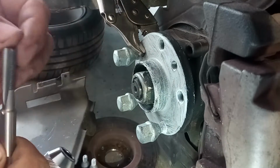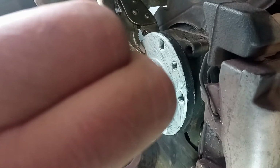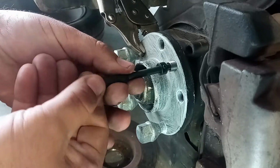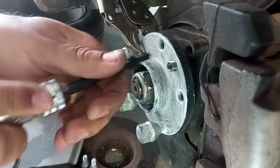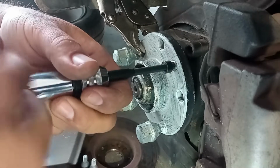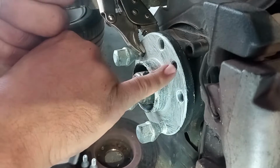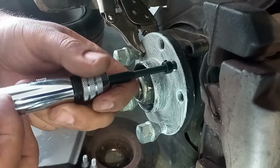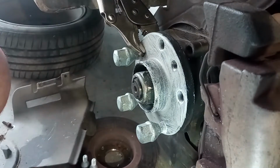This tool here comes with a repair kit, like I said. Also on the repair kit we have a driver over here. I like to use a little bit of Loctite, the blue one, just a smidge. I don't want it to pass through the new bolt. And by hand start it, until it is just under the surface. Okay, that's nice. Now just let the glue dry.